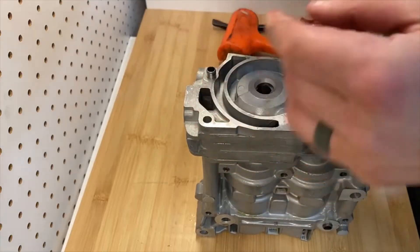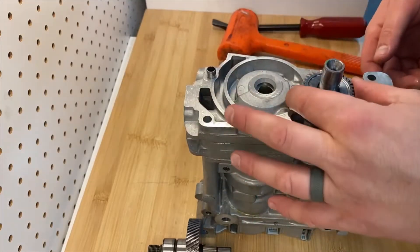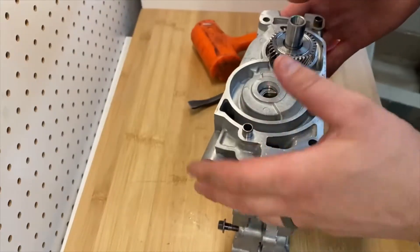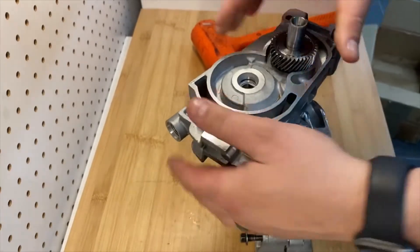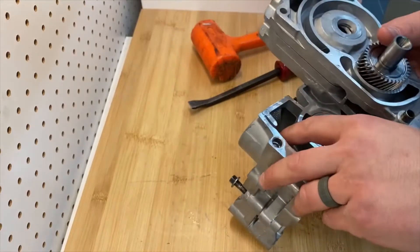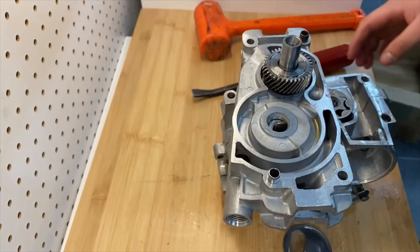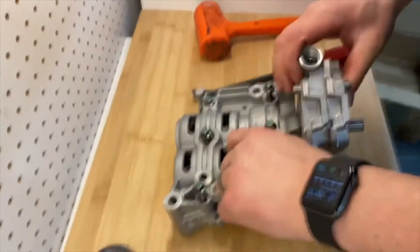This line drives here as well, and it's a perfect fit back there. Next, you have to remove this case, but this part does not come off — it stays through. It is pressed on and you cannot remove it; you have to rebuild this with that piece still installed. Once you have the front cover off, there are two separate pieces but you want to move them together to start. One of your drive gears is here, but there's a hidden bolt down in there, so you need to pop your screen out without damaging it so you can access that bolt.